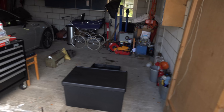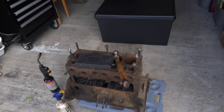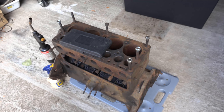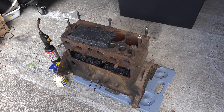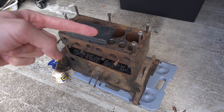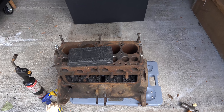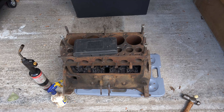The problem with the block is the studs are rusted into it. It's not just the threads which are the issue - the studs go through into the water jacket. What happens is on the other side where the stud is in the water jacket, rust forms there. Imagine on the end of the stud there's a big bit of rust, so when you try to pull it out you're pulling this really rusty bulb at the bottom through the threads - that's the difficult part. If you're really unlucky there'll be a huge amount of rust on the other end and you can't get them out unless you do something like electrolysis or rust removal first.